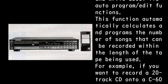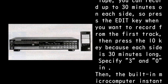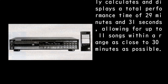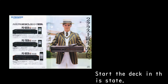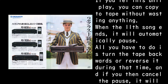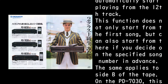This function automatically calculates and programs the number of songs that can be recorded within the length of the tape being used. For example, to record a 20-track CD onto a C60 tape — 30 minutes per side — press the Edit key and then enter 30 minutes. The built-in microcomputer instantly calculates a total performance time of 29 minutes 31 seconds, allowing up to 11 songs within a range as close to 30 minutes as possible. Start the deck and let the unit play to copy to tape without wasting any space. When the 11th song ends, it automatically pauses. Turn the tape over or reverse it, cancel the pause, and it automatically starts playing from the 12th track. This function can also start from any specified track number, not only from the first song, and the same applies to side B of the tape.